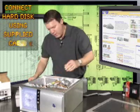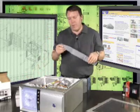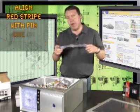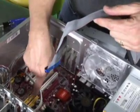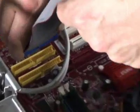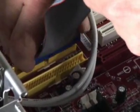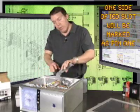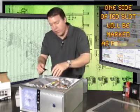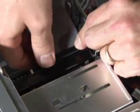We need a cable. The case came with a cable and the hard disk came with a cable as well. On one side of the cable there's a red stripe, and that marks pin one. When you look on the motherboard there's going to be a marker for pin one as well, so you just plug it into one of the available IDE connectors lining the red stripe up with pin one, then insert it on the back of the drive — and there's only one way it can go on the back of the drive.